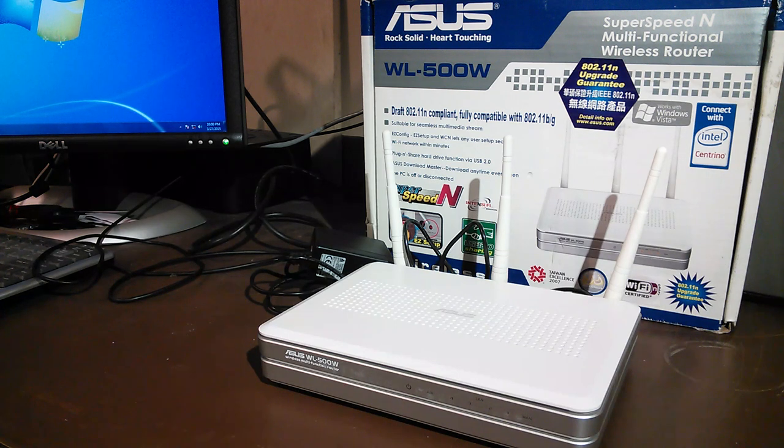So what we're going to put on here today is two different third-party firmwares, DD-WRT and Tomato. My rule of thumb is whenever I'm trying these third-party firmwares, I usually do the DD-WRT first. Then, if I want to install Tomato, I immediately install it after that. I've always had the greater success of installing DD-WRT first without bricking the actual router and then following it up with a Tomato install. So what we're going to do here is follow the directions straight off the DD-WRT website. It's going to take a while, and we'll do screen captures and all that fun stuff, and then we'll go from there.